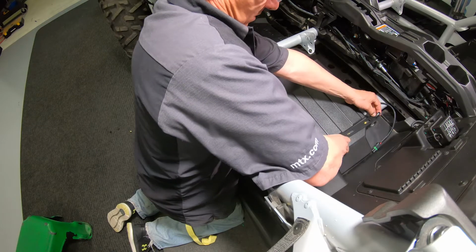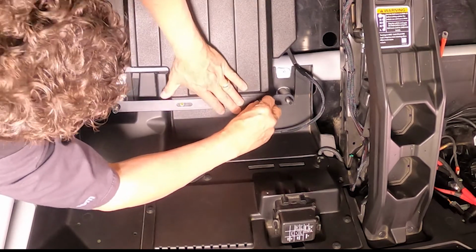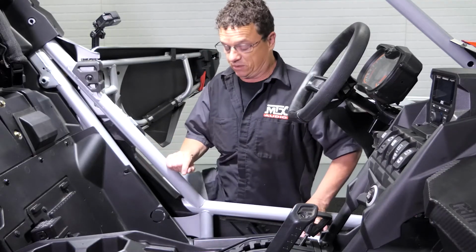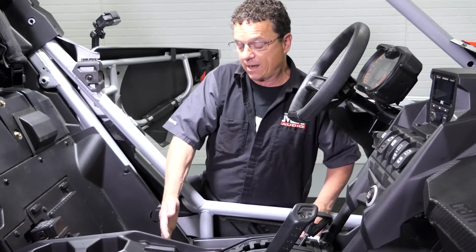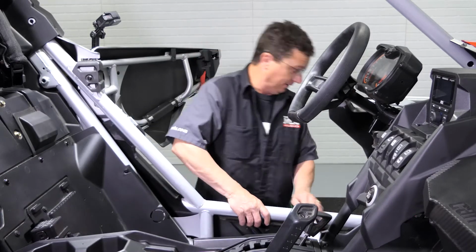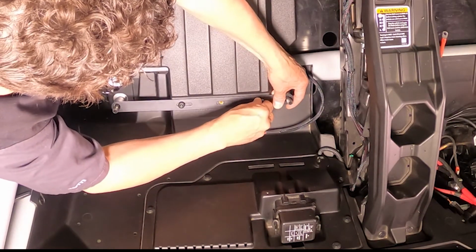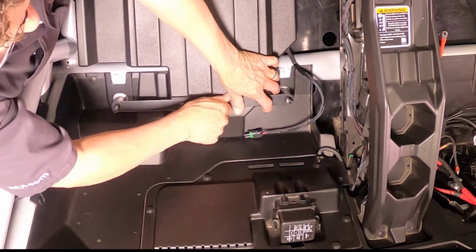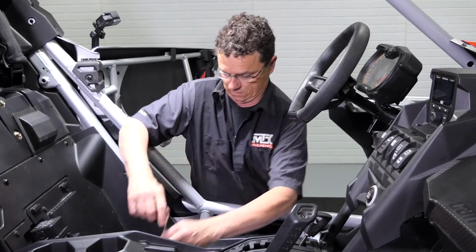And then your rear bracket. This is going to go just like that. And it will get compressed when the seat goes in. You'll notice in some older cars, if you had your seat in the lowest position, sometimes these will actually bend backwards. So this may not line up quite right. So you need to bend these back so that they're in the stock position so that everything lines up. It's really simple, a little piece of pipe or a ratchet or something. There we go, everything's in. Go ahead and tighten it all down.